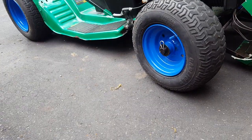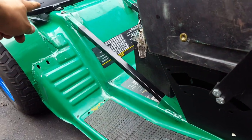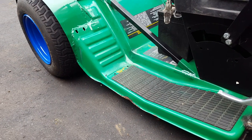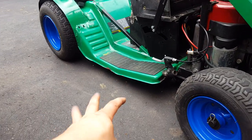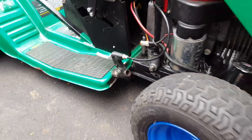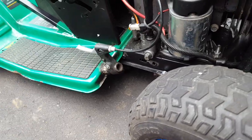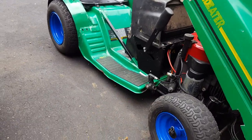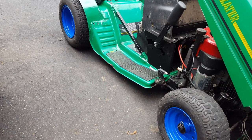The front suspension has been redone completely. The rear isn't much — it's just solidly mounted and braced. I did bracing right here and under the sheet as well because I had to cut so much of the frame out. I braced it because the whole frame would just flex and twist — it's just stamped steel, nothing crazy. This bicycle cable works really nice. A lot of people use a hand throttle on the steering wheel — same thing out of a bicycle — and I'm used to it; it gives that car feel.